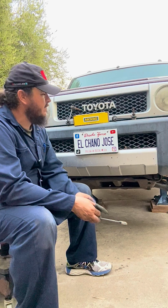Well, folks, hopefully this video was useful and helpful on how to replace the link kits on a 2007 to 2014 Toyota FJ Cruiser 4x4 or two-wheel drive front sway bar, and a 2003 to 2021 Toyota 4Runner as well, or a 2004-2020 Lexus GX 470. And this is pretty simple. All the tools that you need are a 17mm wrench, a 6mm Allen wrench, and you need the left and right link kit for this vehicle because they have left and right. And the brand that we're using is Moog, because it's one of the most known brands out there.